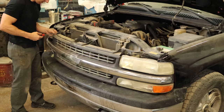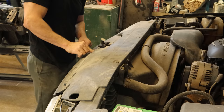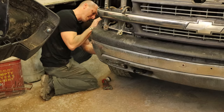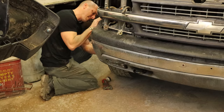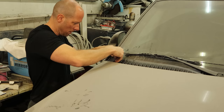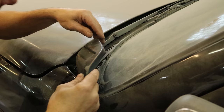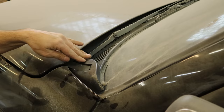One in each corner — just turn them 90 degrees and they lock in, they have Phillips heads on them. Clip in the other side, and there's one bolt in the center. We'll throw our closeout panel up on the top and put all our little push pins in it. We can bolt the bumper brackets on the outer edges, get it all lined up so it's got an even gap. We'll put the little panels on the edge of our cowl panel to cover up the hood hinges. On this side we've got an antenna that sticks through it, so we'll bolt that in. Now for the most satisfying part of this build — peeling the plastic off of our brand new fog lights. I opted for the smoked ones.